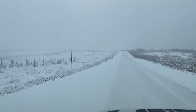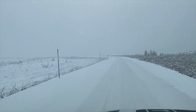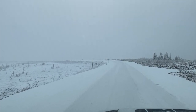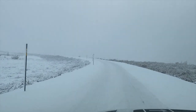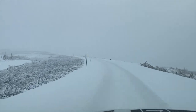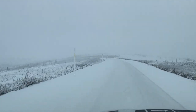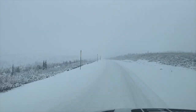I've now selected standard comfort mode and I'm going to hump on the brakes again — we're doing 65km/h. Well, there's a bit more slip I can detect there — a little bit more wheel slip, as the setting is intended to provide a bit less sensitivity to slip. I think it probably stopped a little bit quicker too, which is interesting. There was a significant amount more slip — quite a lot more slip, in fact; so much that I could feel it with my foot.